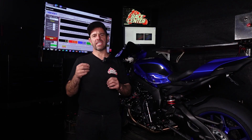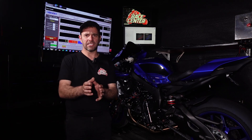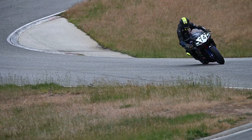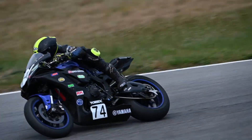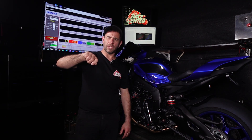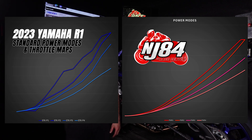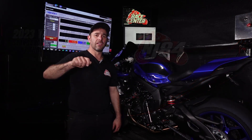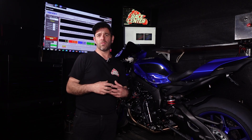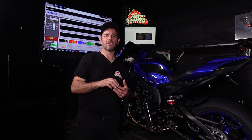I always say the more you trust it the more you'll use it. At a racetrack with the NJ84 throttle maps, the bike is so smooth and predictable that you'll use it fully. Going into a corner fast carrying a lot of entry speed and mid-corner speed, if you've got the OEM map doing weird things you'll be second-guessing the throttle and hesitant. You won't carry enough corner speed for just a little throttle to create a nice gentle slide, because with the OEM map a little input gives you a lot more than expected and you have to back out.